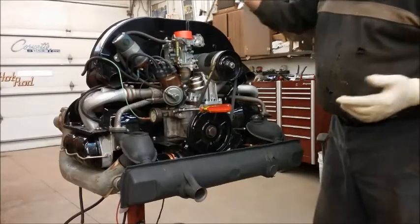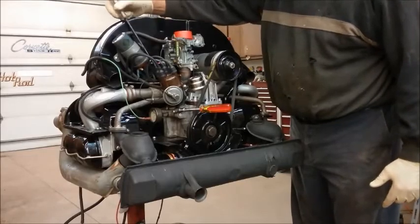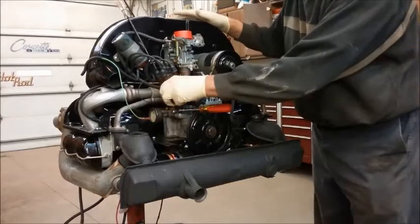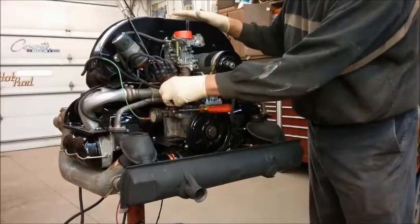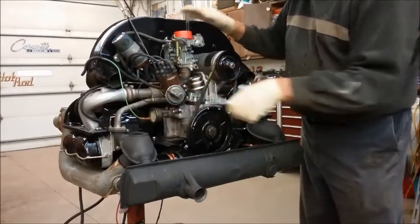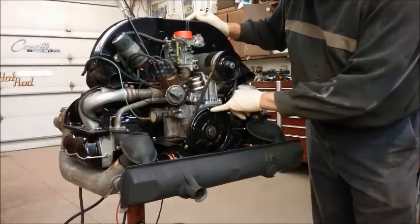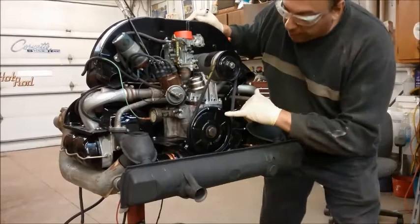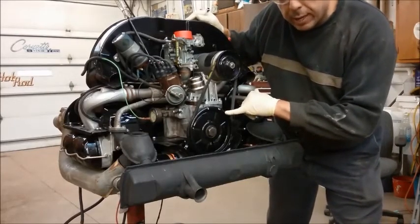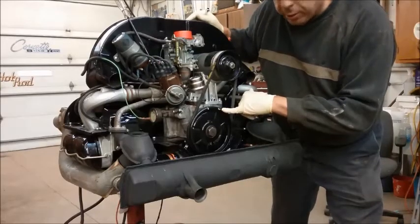What I'm going to do is take a regular 12-volt test light and stick that in the coil negative right there so I can watch my power. What I'm doing right now is watching the power at the coil negative. I've got my timing set right here, my crank set at about 10 degrees before top dead center. I've got my zero mark, and I've got my 30 degrees before top dead center, which is where I'll set my timing at full RPM — wide open throttle or close to it, like 3,000 RPM, at 30 degrees.